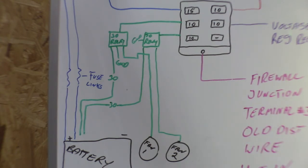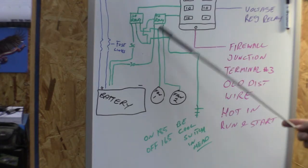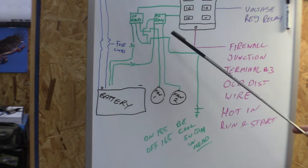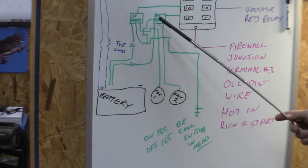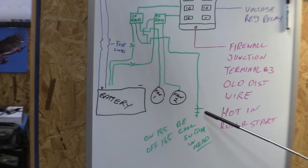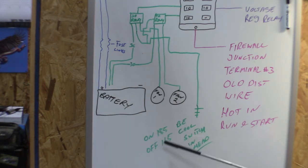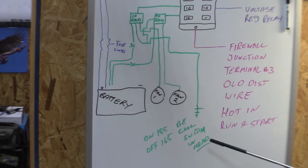We brought the third grader back in and fixed the artwork to show you how it's actually wired up. You can see the two relays — the grounds tie together and come down. I had shown it as a ground symbol, but it's actually going to a Be Cool switch that comes on at 185 degrees and goes off at 165. I'll put a link in the description for this switch — I actually had it left over from another project, but you can purchase it separately.